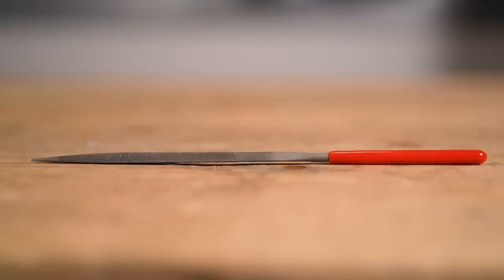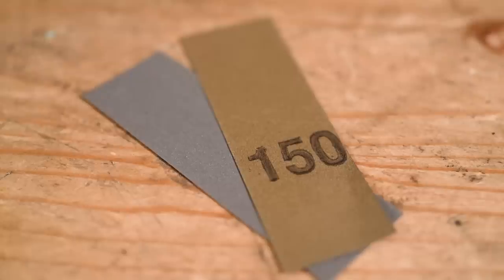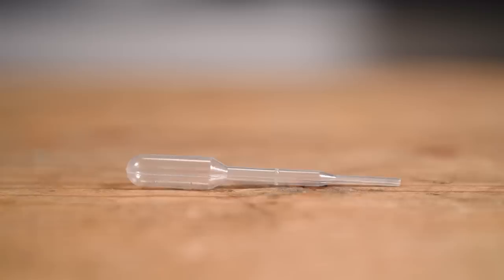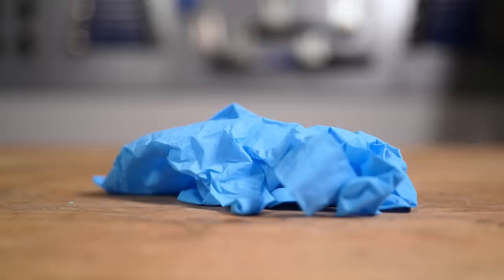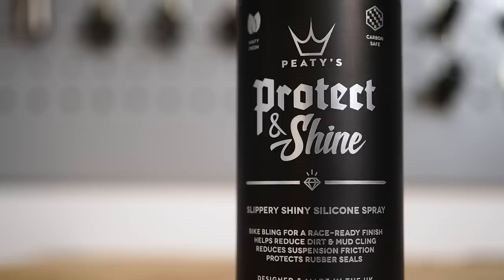A 140 grit file, a two-to-one ratio of resin to hardener, a mixer tube with measurements on it, sandpaper — preferably 150 grit or more — a sanding wedge, a pipette or a clean nail varnish brush, cleaning wipes or isopropyl alcohol and a towel, a pair of nitrile gloves, wet lube, and some silicone spray or suspension oil like Fox Float fluid just to finish off.